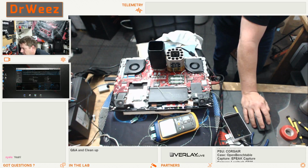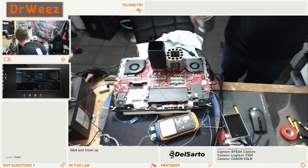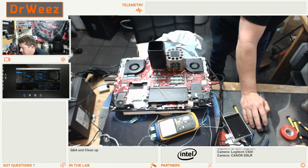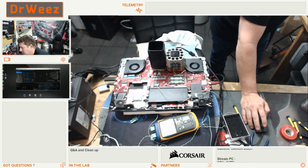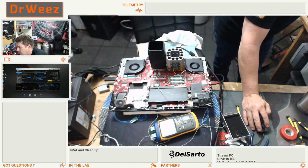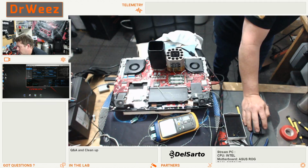Right, so let's give this another whirl. We'll go back to the settings. Now, I've tried minus 25, which might have been a little bit too much. We'll try minus 10 and see if we can run 51 then. Right, so if you disable any of the turbo boost technologies here, you go back to your 29 multiplier, your max non-turbo boost. For R11 I might very well have to add some voltage. Actually, let's try adding before I go with removing again. I wasn't watching terribly closely what the core voltage was when it blue screened.